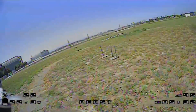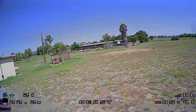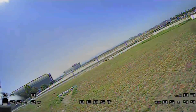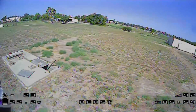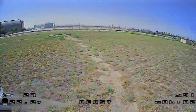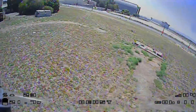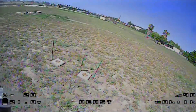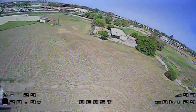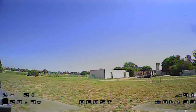The VTX seems to work pretty well with no real signal breakups. Flying 6S feels like the power is about the same, but I can feel a little extra weight. I'm getting a really long flight time here — almost six minutes at 22.2 volts and I could go a little longer. At 21.7 volts, the 6S LiPo still doesn't sag much. Even with a punch-out you don't get as much sag as you would on a 4S LiPo. The battery is now at 20 volts — that's going to do it for the demo, bringing it in for landing.